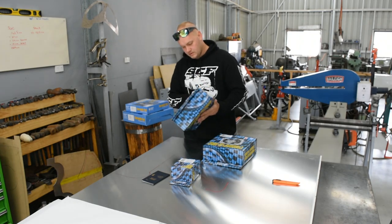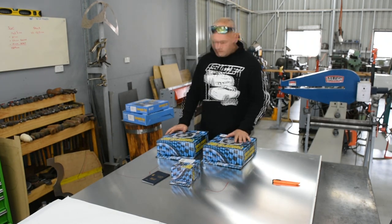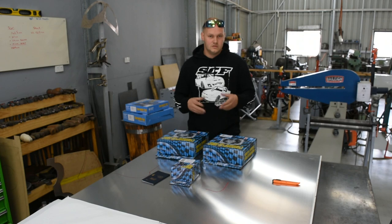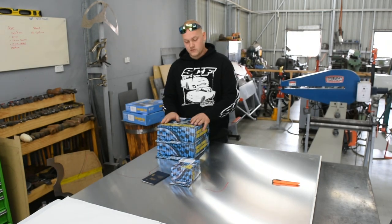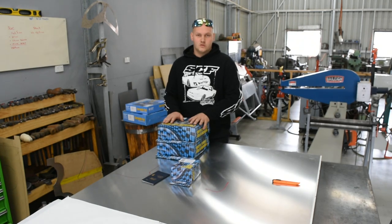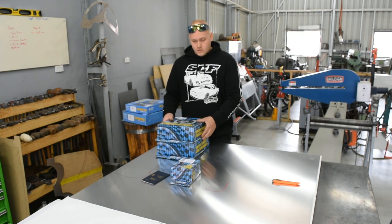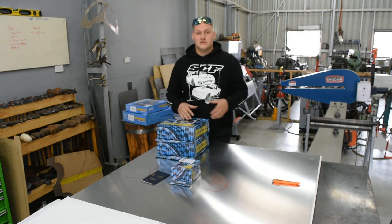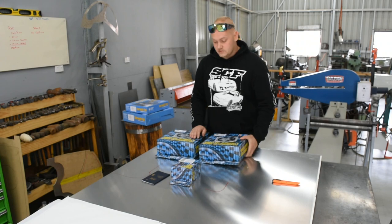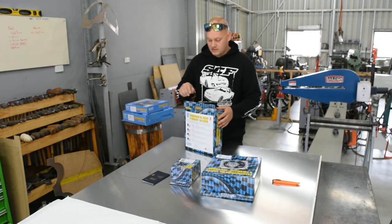On this car we're going to be running a fully built Turbo 400 with a good sized stall converter. Burnout cars have an issue with heat because you're not moving — you're not getting airflow through the motor and through the front of the car. You're essentially just going around in circles, and if you don't have the cooling up to standard, cars can overheat really quickly. A burnout might go a minute and a half, two minutes — but temperatures can soar through the roof, especially on burnout pads like Summernats where it's a small pad with high concrete walls. So what we've chosen to run is twin coolers and fan setups on the transmission.